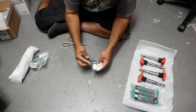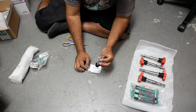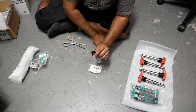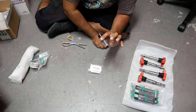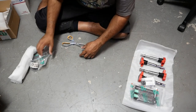Here's an ARP crank bolt — yet another very important product for your high horsepower 1.8T. This adds a lot more extra clamping force onto your crank gear. When you're up at those high horsepower numbers, this is one part you do not want to fail because you'd have to rebuild or buy a whole new motor.